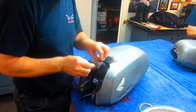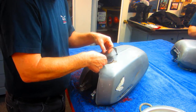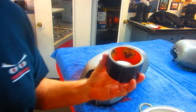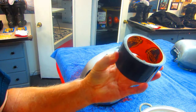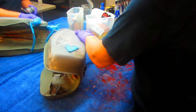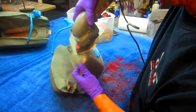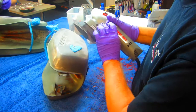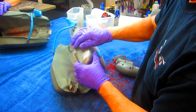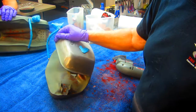For the fuel cap I always prefer to use Gorilla Tape — anybody who doesn't know about it, it's like super duct tape, really good stuff. This tank is going to need quite a bit of bondo work — I checked and it's dented in several places. So I want to rough sand everything before I bondo it; it'll help the bondo stick better too. Ray mentioned these tanks tended to rot out on the bottom, so I'm going to be very careful not to sand the bottom — and put a little extra paint on that to protect it.